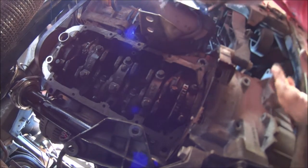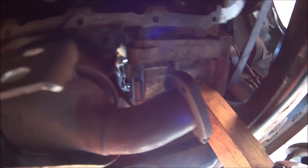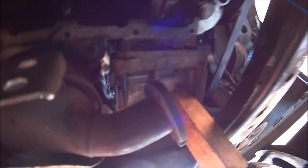Hopefully it's not too dark under here. I'm actually sliding the sump into there. I've done a few dry runs to test it out. What gets trapped is up at this end and trapped on this cross beam, and that's where the oil seal wants to go. So what I've done is cut a piece of wood to length, put it on the alternator, and I've got a jack. I just took the engine up slightly so I've got a bit more room in there.